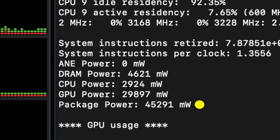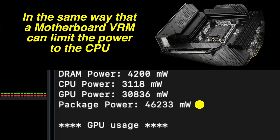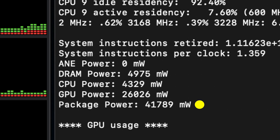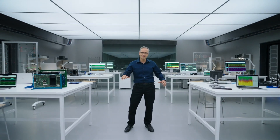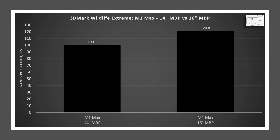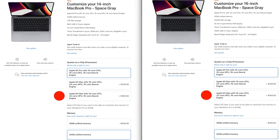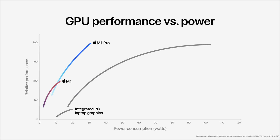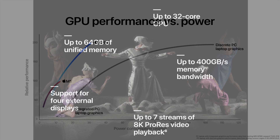The only conclusion you can draw is that the M1 Max in the 14-inch MacBook Pro has a 45-watt power limit. The power supply in the 14-inch MacBook Pro can only supply up to 45 watts long term — it can boost for short periods, but will always reduce back to this limit. Based on this testing, we can definitively say that the M1 Max in the 14-inch MacBook Pro is not thermally limited — it is power limited. The engineers at Apple obviously know the 14-inch cannot provide the same performance as the 16-inch. You will get 10 to 20% lower performance, yet you pay the same price for the M1 Max upgrade in the 14-inch as in the 16-inch, meaning the performance per dollar and value will be lower.